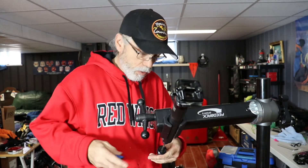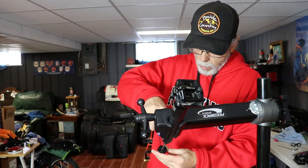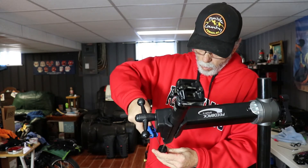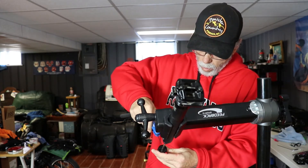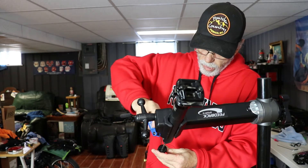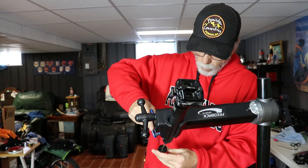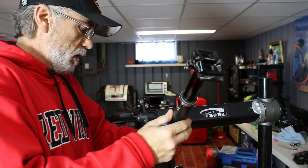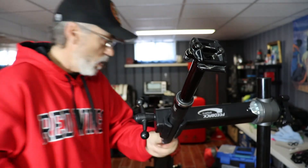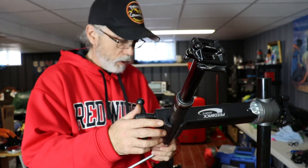You're better off to leave it down here so that you can use the angle of the seat post so the screws aren't dropping out all the time. Don't screw one all the way down — kind of go back and forth so that this sits straight and one isn't pulling it one way. Then slide it back up and screw it back in — you can go by hand for a little while, and then you'll have to grab your tool again. This doesn't have to be tightened down excessively, it's just more hand tight.